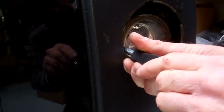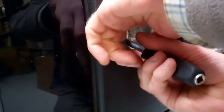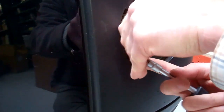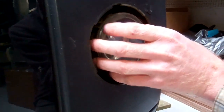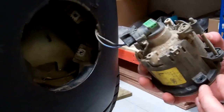The three screws are roughly at the two o'clock, four o'clock, and nine o'clock positions as you look at them. Obviously that'll be the opposite on the other side of the car, but the process is exactly the same. This process could also be used if you need to change the fog light bulb.